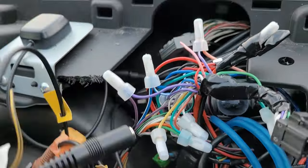Update. It did work. So what was happening was, when this puppy came on, right around the time it booted, we would have a white noise because the output was very high. And so now it's gone. Beautiful. So RCAs did it. Gotta do the RCAs, not the high voltage. So, there you have it.